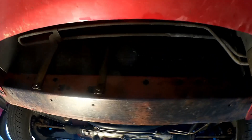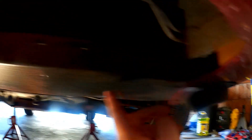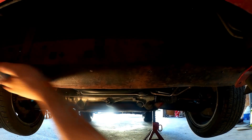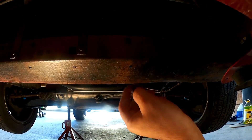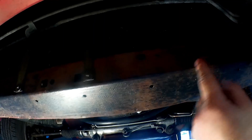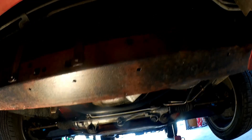What we're going to do is repair this thing, because I noticed it's a bit flappity, and then go ahead and install it. Now this is black and dark looking because I put some phosphate coating on it. The paint had worn off over all the time this thing's existed and it started having a little bit of surface rust. There's no cancer rust — you can see those are nice clean holes. This car doesn't have any cancer, but there was surface rust, so I painted some iron phosphate on there to keep it from continuing to corrode.